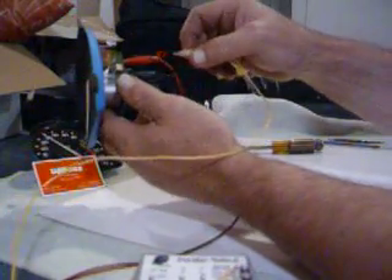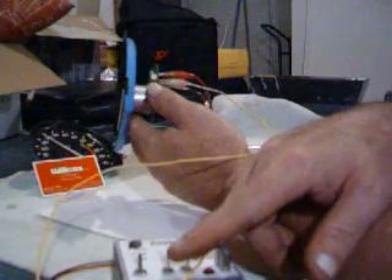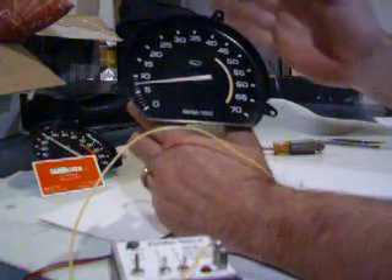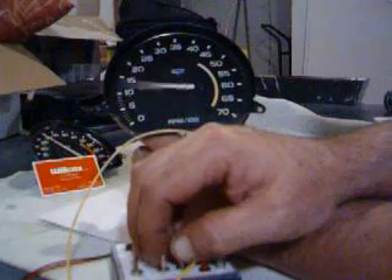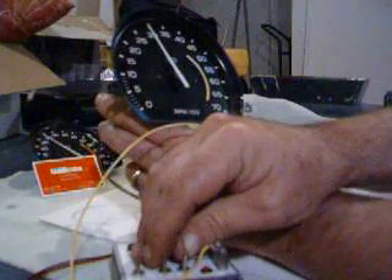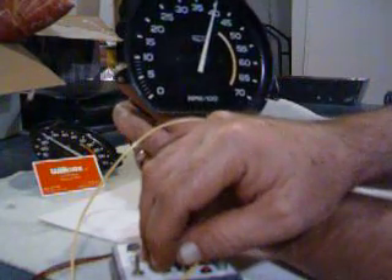The next thing is to power up Frankenmeter — I'm not going to go into how it got its name — and put a signal on there. Once we turn Frankenmeter on, the two levers are down to 700 RPMs. Our tach is reading 700 RPMs. I don't see any reason to calibrate that; it's on 700. We throw it up to 2,000 and the gauge is on 2,000. Then we hit 3,000 — it's just a little bit off, maybe a zero or ohms issue — but we're within 50 RPMs of 3,000. Then we hit 4,000 and it's right on the money.